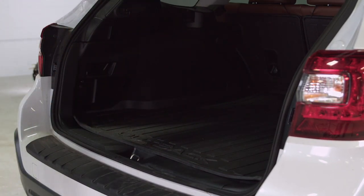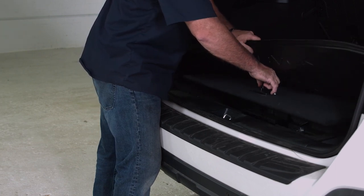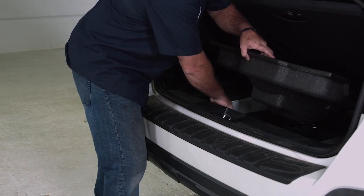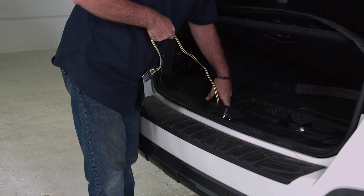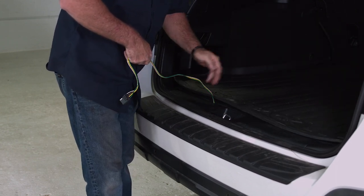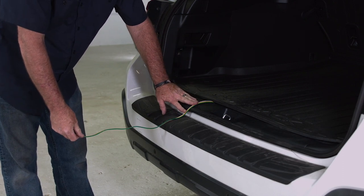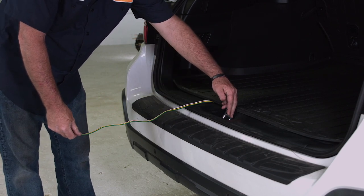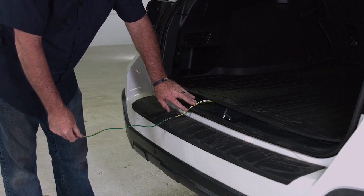That's it for our four flat wiring harness on this Subaru Outback. When you're ready to use your four flat tow harness, just lift up the floor mat, lift up our center paneling, the storage jack, and pull out our wiring harness — it all goes back together. Then let the harness hang over the door seal. You don't want it over the door latch because that will crush the wire harness, but it's perfectly okay over the door seal.